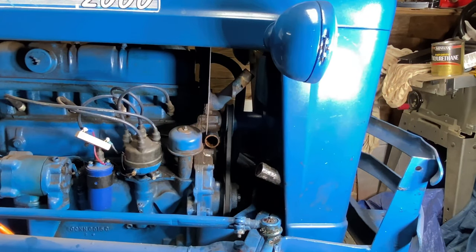At this point it's just a matter of putting all the hoses back on, making sure they're tight, and then putting the coolant back in the system. I'm going to be putting fresh coolant in it and fresh hoses on it. You want to make sure your antifreeze is at least a 50-50 mix. Me personally, I mix mine 75% antifreeze and 25% water — I've had less problems with water pump seals going out at that ratio versus 50-50. But you can do it your way.